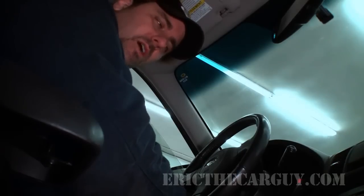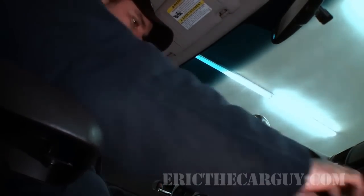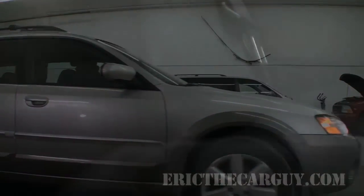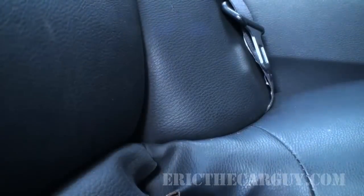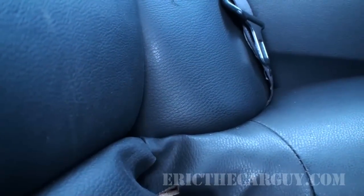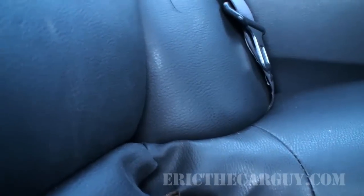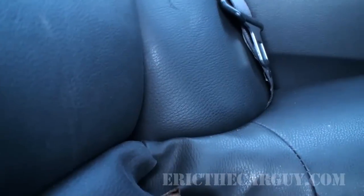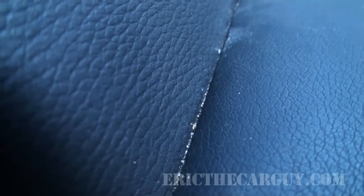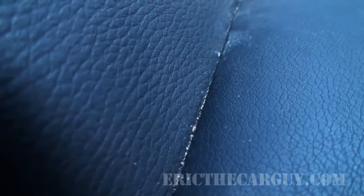All right, well, let's start by taking this thing for a drive. Now, I've placed you in the back in the area where I believe the noise is coming from so that you can hear it the best. I'm gonna find some bumpy roads. Yeah, I don't know if you heard that or not, but there was kind of a knocking and sort of a squeaking that went along with it. Sounds like a rubber bushing has failed.